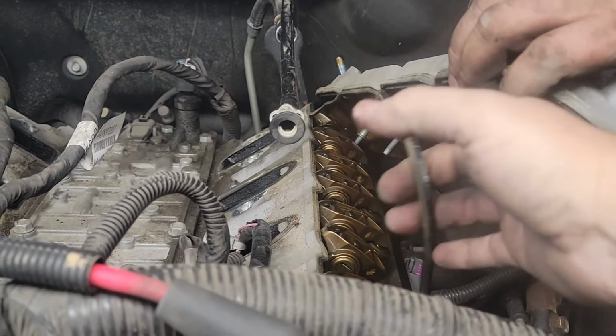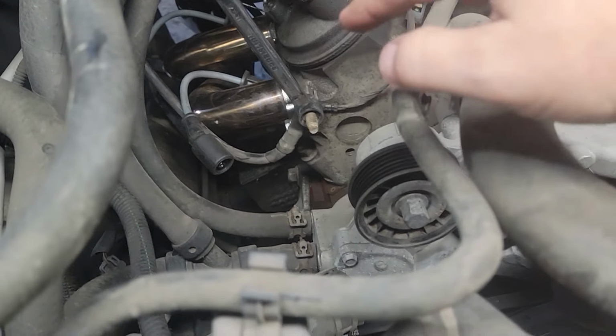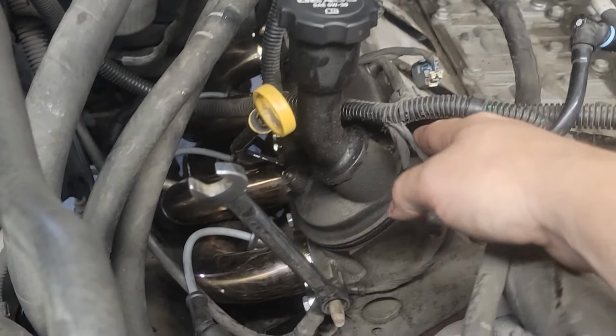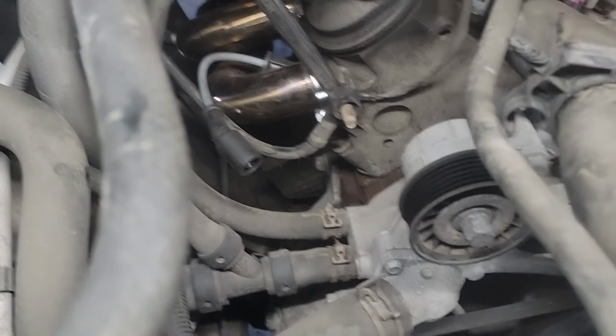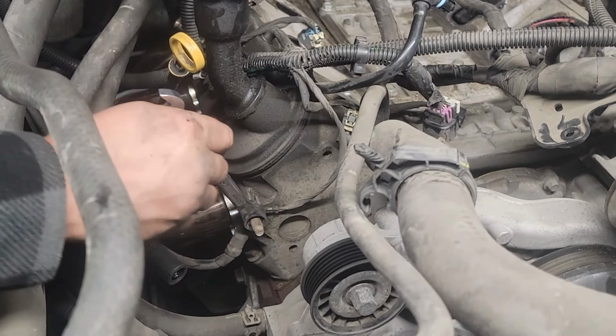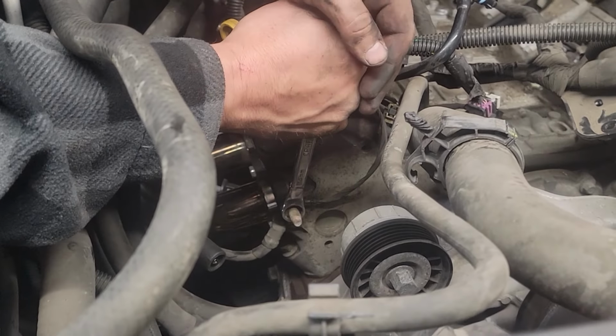So one thing that does have to come off is a grounding strap. There's 2 separate grounds going to the 1 bolt. So once you undo it there, you can get this line here off, which then you can get your valve cover off a little bit easier. So we'll go ahead and take that grounding bolt out now